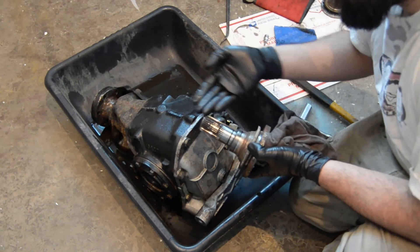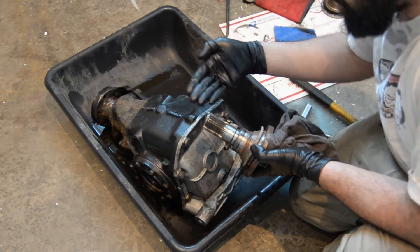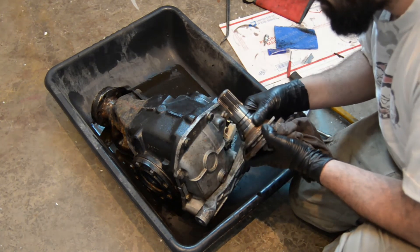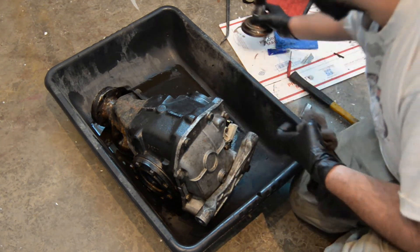The last thing you need to know is that your stub shaft is now too long and you need to have 4mm milled from the end, and then also have it chamfered and deburred.